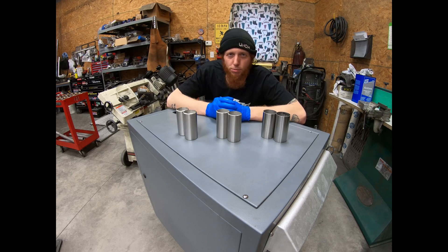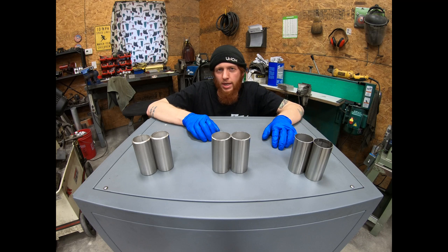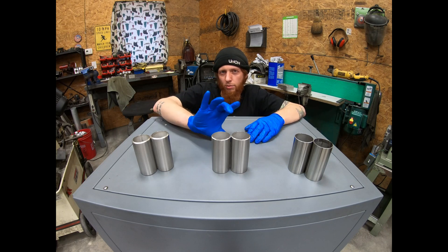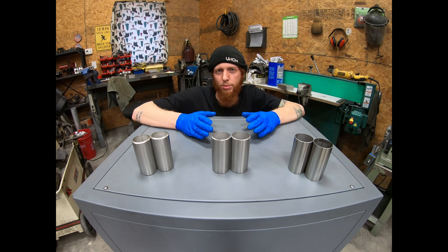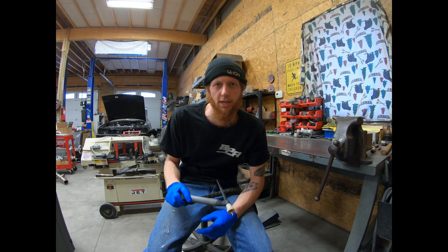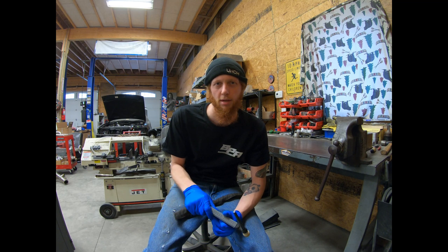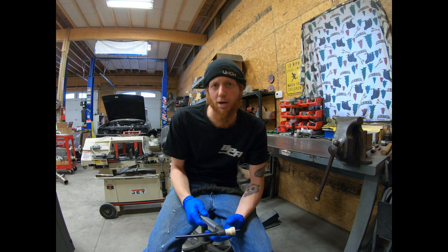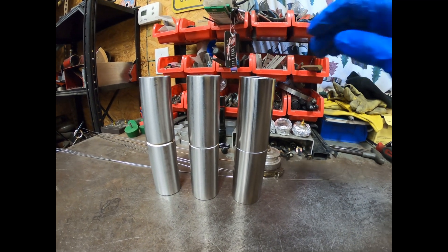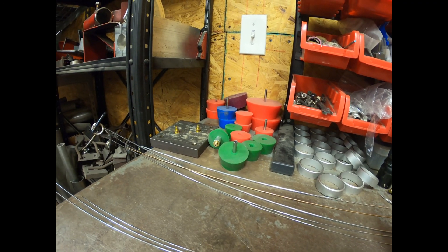For anybody looking to compete at the highest level in motorsports and have the lightest parts possible, Inconel 625 is simply a no-brainer. Since I have pieces cut from 304 stainless, 321 stainless, and Inconel 625, let me do a weld for you so you can see the aesthetic difference between each material and then weigh the pieces afterwards to see the actual weight difference. Each stub here is approximately four inches in length, giving us eight inches overall for each piece, which should give a good idea of both weight and aesthetics. For this test I'm using my SPW 14 gas nozzle on my CS310 TIG torch, setting amperage at an appropriate level for each material thickness, keeping gas flow constant at 30 to 35 CFH, and properly back-purging each weld joint using my TIG Aesthetics silicon back-purge plug kit — I highly recommend getting a set of them.